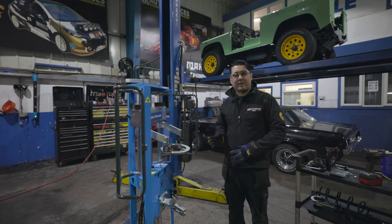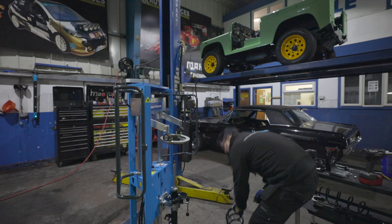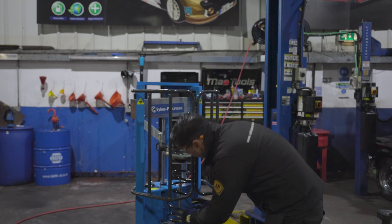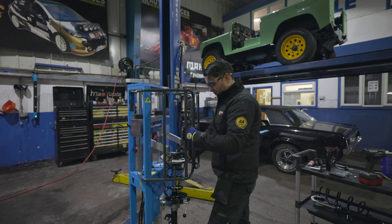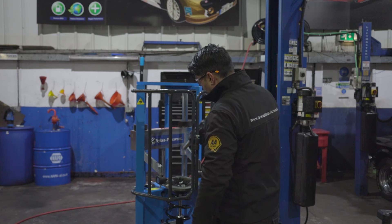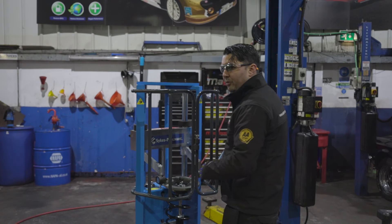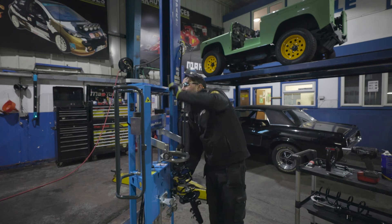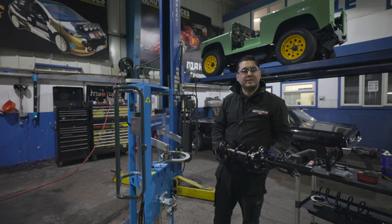Like the C-Class, taking it apart is a lot easier than putting it back together — so let's get this one reassembled. Strap the shock up, centralise it with the ram again. Because we've got this pivot, we can drop the spring straight in — no effort whatsoever. Now we've got the shock straight, the spring in position, and the top mount already bolted to the top mount plate, we can just lower the spring down. Because it's on a pivot, as we drop the shock down we can just locate it and once it's started you can take your hands away and see it's pushed straight down. Put the gun straight in while still in the cage, gun it up, and you know everything's straight because you've located it on the top mount plate. Take the spring up — complete Nissan Qashqai shock, all in place, all located safely, in less than five minutes with one person.